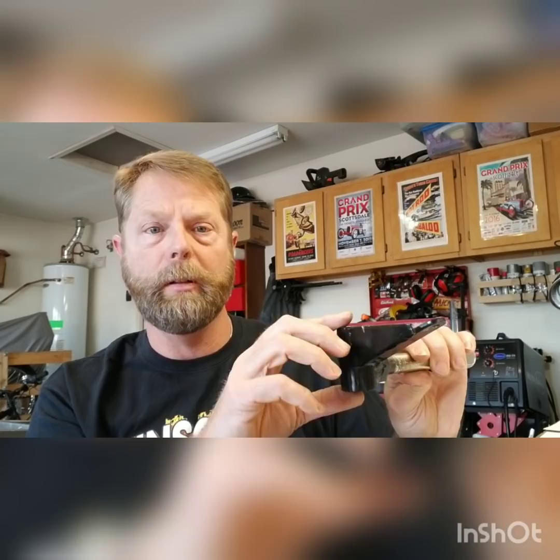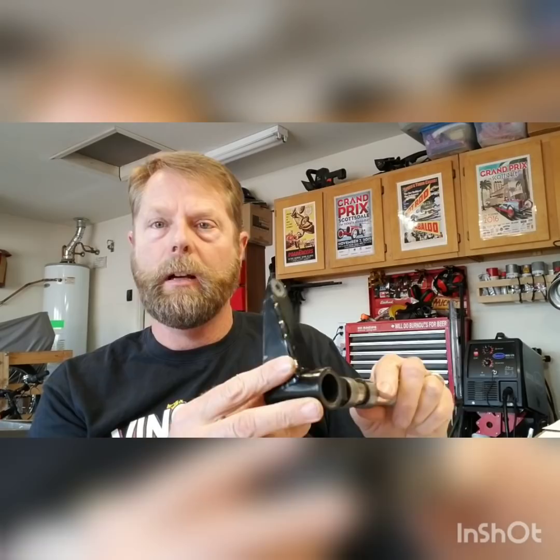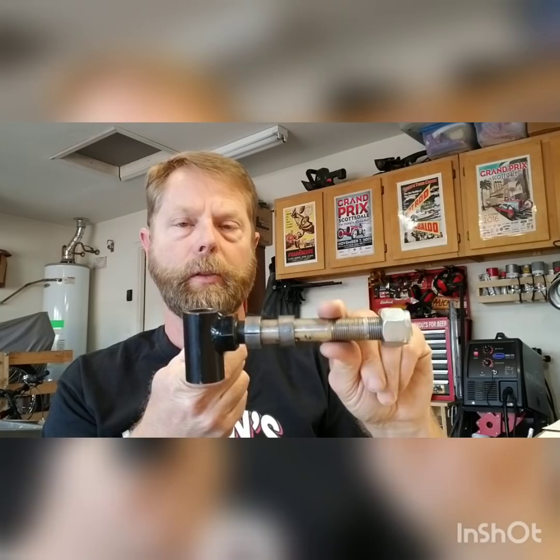The current cart I'm using has got the Azusa-style spindle, which is this. This is a recreation made by Vintage Cart Co. They took the Azusa and improved it by putting bushings in it, like these little bronze bushings. So this works really good. It's kingpins straight up and down on this application, perfectly 90-degree angle, the three-quarter inch bolt. Vintage Cart Co.'s basic ones have 5/8 inch bolts to fit their reproduction wheels, but this fits the original Honda wheel. So that's why we got a three-quarter, which is probably better anyway because it's a little stronger.